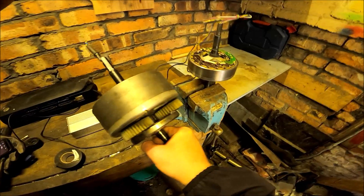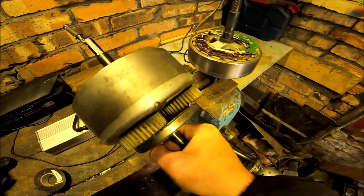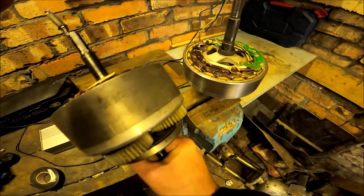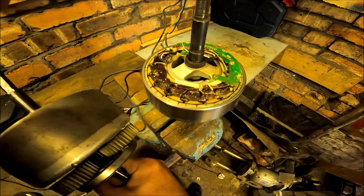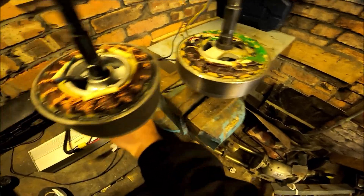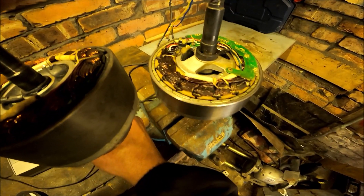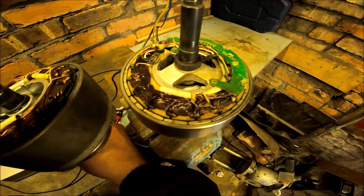The basis of the problem is I bought this smaller motor some time ago and foolishly thought they were all just the same - just called them 350 watt and 750 watt. Obviously this larger one has much more metal and can take a lot more heat dissipation. So running two and a half thousand watts into a 350 watt motor, I quickly burnt it out. It appears the phase wires survived, the coil survived, but the actual magnets came loose when it overheated. There are the two motors alongside each other - I didn't really notice a lot of difference in actual power output, it flew along perfectly well and climbed well, but then all of a sudden it just stopped providing any drive.